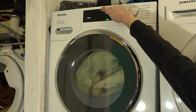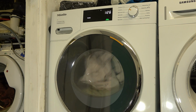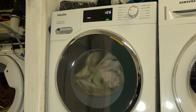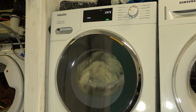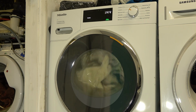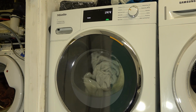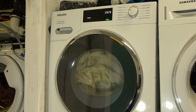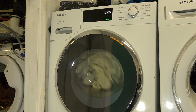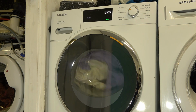So we've got this perfect dry light flashing away. So during the first few minutes, probably not even that, the tumble dryer is currently trying to detect how much moisture is roughly within the load. So the time's now gone up already, but we've still got perfect dry flashing away. So perfect dry light has now gone out, which means it has now detected the moisture content. This time may go up or down as well throughout this cycle.